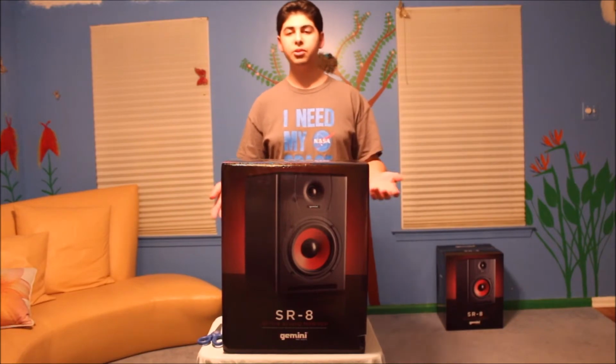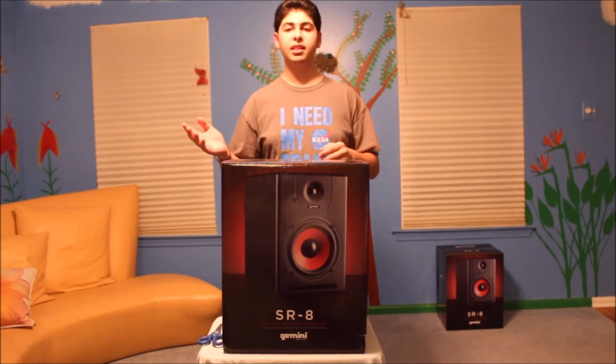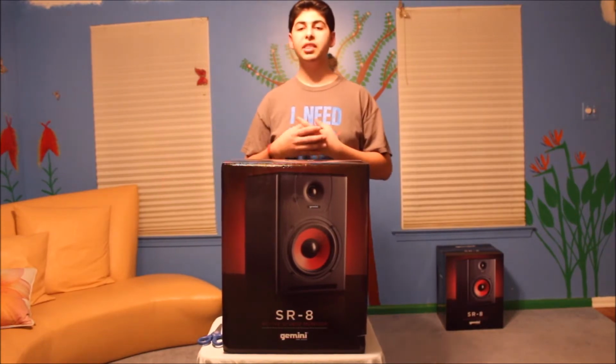Now, you may be wondering to yourself, what do I need studio monitors for? How are studio monitors different from, let's say, computer speakers or your stereo speakers at home? Well, studio monitors have an entirely flat frequency response. So this means when you're making a video, editing that audio on the video, making a song, mixing a DJ track, you're going to get a flat frequency response. So no part of your song is going to be emphasized, and when you go to play that song or video on a different speaker, it's going to sound the way that you wanted it to sound, and it's not going to have less sound in one area of the frequency range.